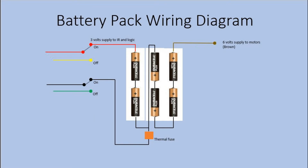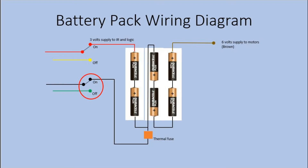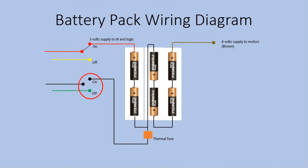The battery layout is quite interesting: four batteries supply six volts and the other two supply three volts, presumably for the infrared receivers and the logic circuitry. I've put a little circuit diagram in with the video. There's a common thermal fuse and I checked it — it was a perfect short, so that wasn't the problem. That really only left the switch, and in my case the negative return line element of the switch just wasn't working; it didn't switch either way. Where the green and yellow wires go I didn't investigate, as I didn't think it was relevant.